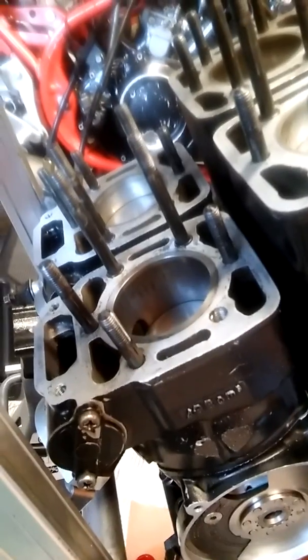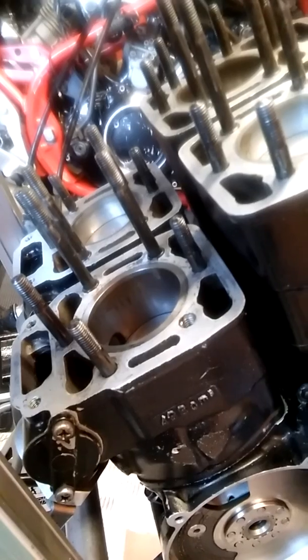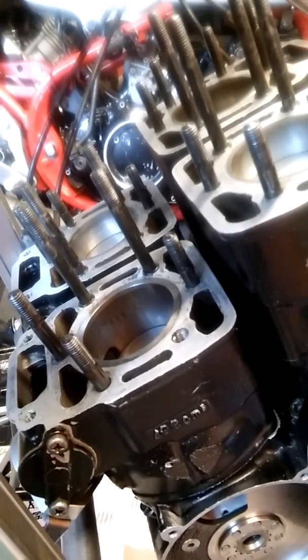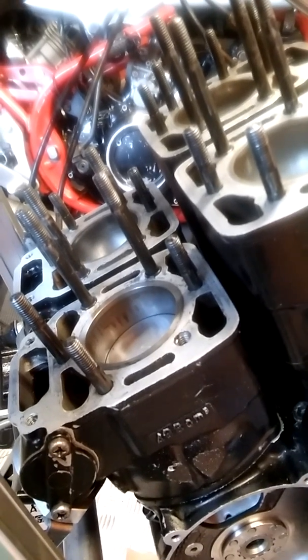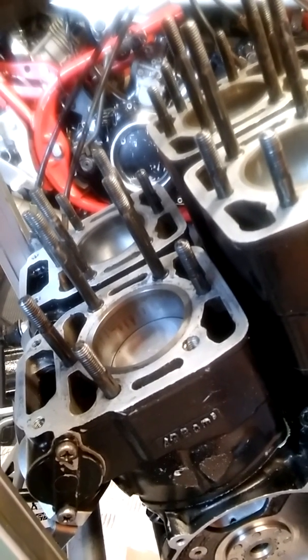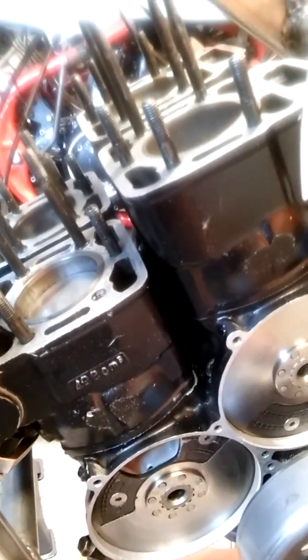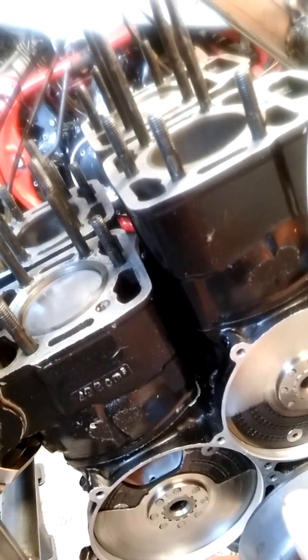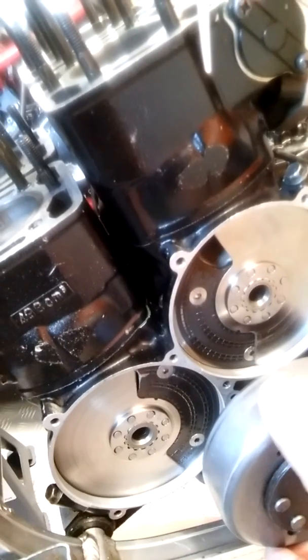The transfers are just about shut on one and three. You're still pushing exhaust out, so you're only compressing from there — compressing the mixture now on one and three. And then boom, it fires and goes around again. I think I've done a full cycle there.